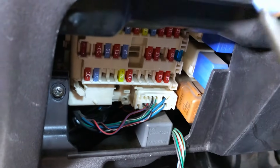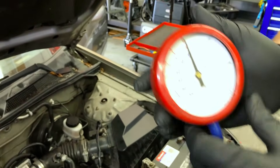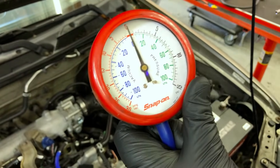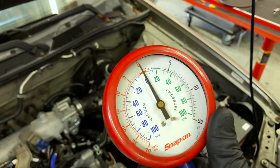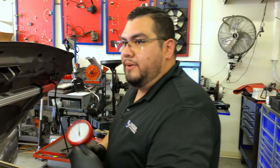I'm going to turn this engine off, disable fuel, and rerun the test so you can see what a cranking vacuum test looks like. The connection is exactly the same — connected to a vacuum port. Since the engine won't be starting, we're just going to crank it and watch for three to five inches of vacuum. With the engine cranking, I saw about three inches of vacuum. That tells me this engine is fully operational — so if I'm diagnosing a crank-no-start, I know it's not an engine mechanical fault, and I need to check fuel, ignition, or in some cases the anti-theft system.